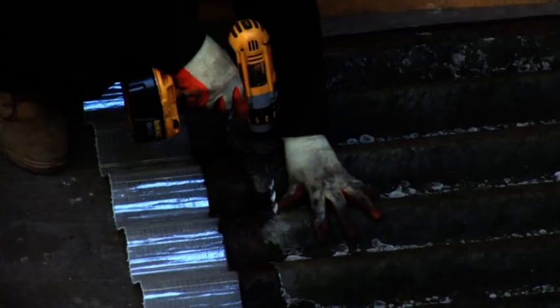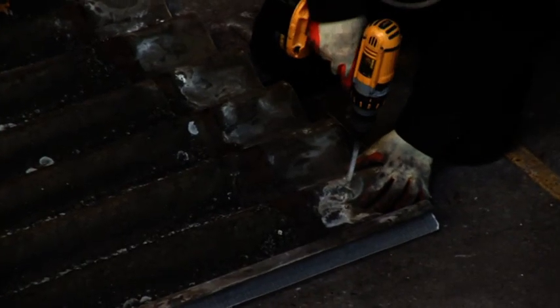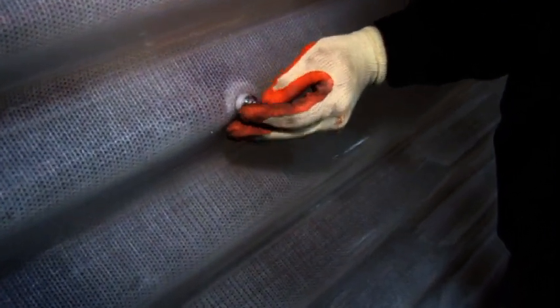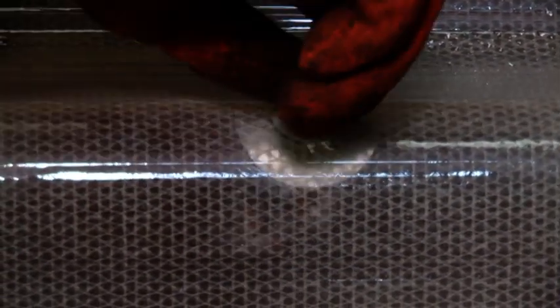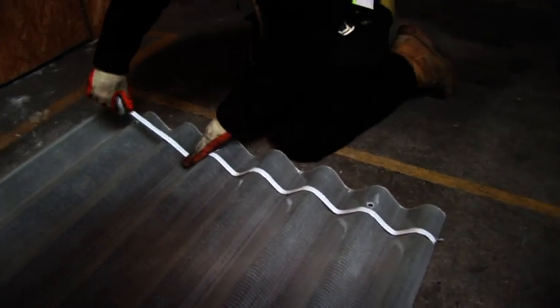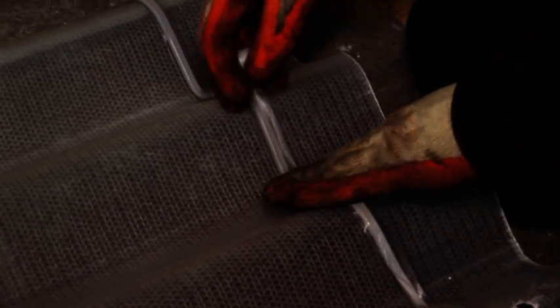Safely on the floor it is easy to drill and cut the new sheet to fit. Then insert the new Fix Safe downslope fittings finger tight. The appropriate sealant can be applied to the new sheet and the perimeter of the roof aperture, either with a gun or by using the tape method shown here, together with a clear overlay tape that will allow the sealant to slide during positioning and then dissolve later in moisture, allowing the sealant to adhere.